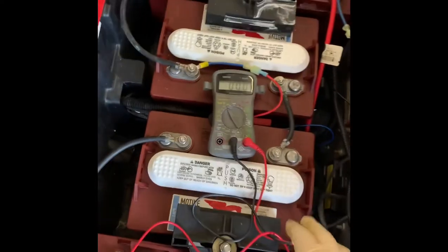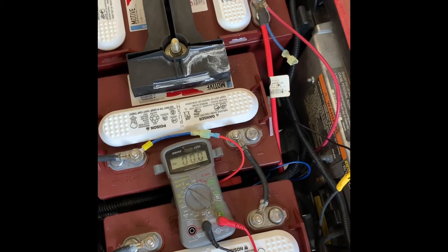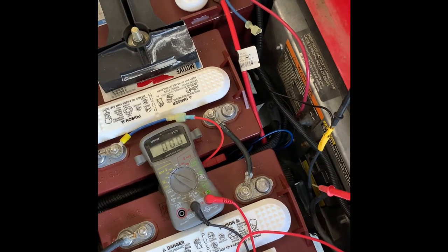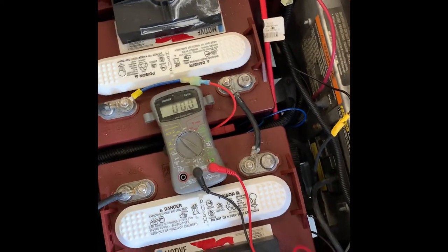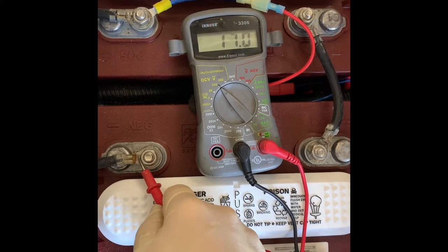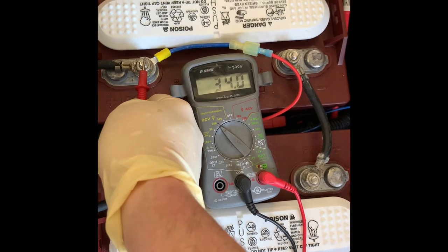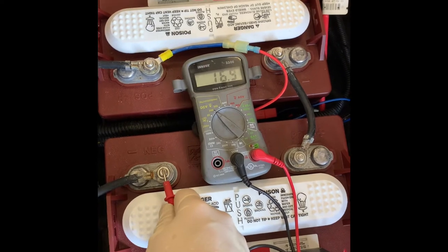I don't want anyone using this video for how they should wire their light kit, because this one is run through a voltage reducer, so it's wired differently than if you did not want to use a voltage reducer. With your harness, you'll have a little plug back here that plugs into the OBC — but if you don't have the OBC, there'll still be a wire here for you to plug your male into the female end. If you're trying to find your 16-volt point, it's actually going to be at these positives right here, which reads about 17 volts — enough to run an LED light kit. Do not use the voltage reducer tap, because if you plug in your lights there it's going to blow your light kit. If you want to run 17 volts with a full LED light kit, you can hook it right here.